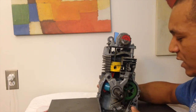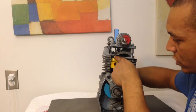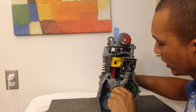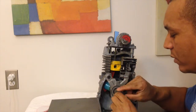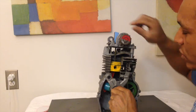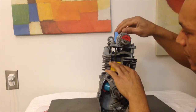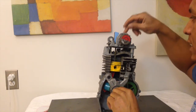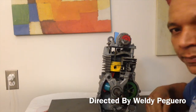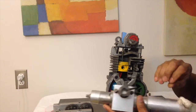When you start the engine, the starter rotates the crankshaft and puts compression inside the cylinder so the first cycle can start. Once the first cycle starts, everything keeps going. We're not taking any power out through the crankshaft — all the power is taken from the top, because this is connected to the piston, not to the crankshaft. Every time it's pulled down, the gear and clutch convert it into mechanical power. That's how linear motion is converted into mechanical rotation.